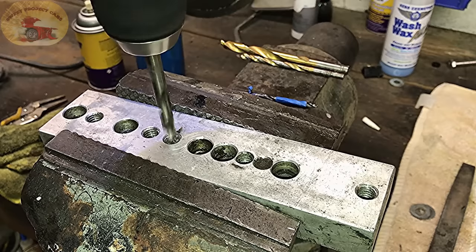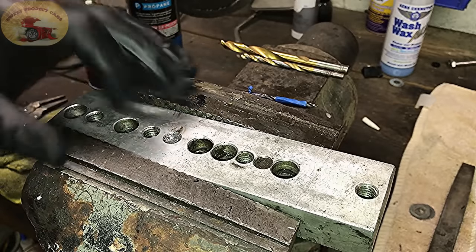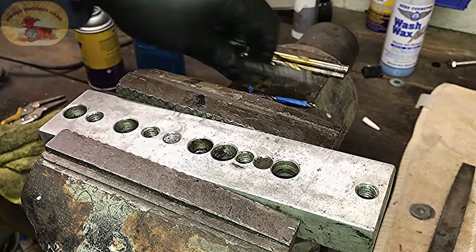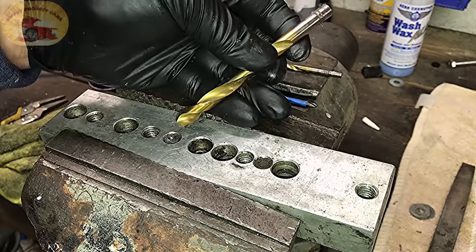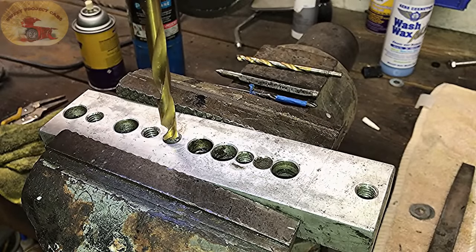You get over it and see right where you're drilling. We'll make that divot even larger — like we put a much larger dent in it with our punch. Then we'll go to an even larger drill bit, grab the Dewalt, and drill it out even larger.